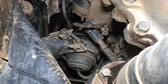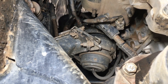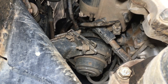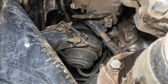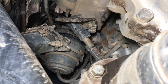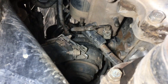Interrupted by a phone call but I thought it's probably worthwhile showing you. This is the view from underneath the vehicle, from the rear side on the passenger side - that's your view. You can't really see much from here. To give you an idea, the bolts you need to undo to change the mounts: right in the middle of the picture there are two bolts, and there are two on the other side as well from memory. There should be a couple each side. You've got the actual main mount which is that round canister-type part, there's a nut on top that goes through, there's a cast bracket that bolts to the block with approximately four bolts. That bolt there just below the starter motor wire - that's one of them, just to give you an idea.